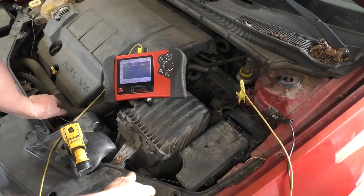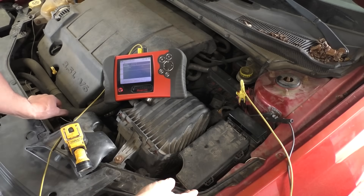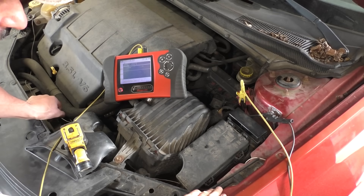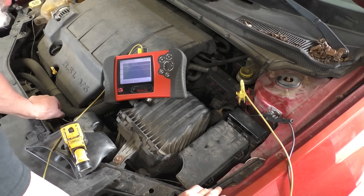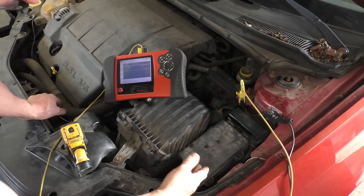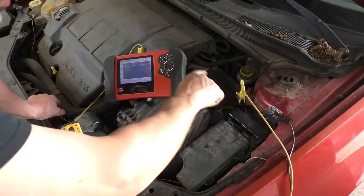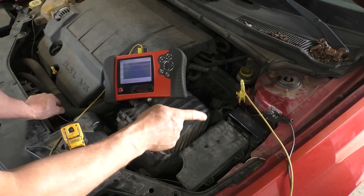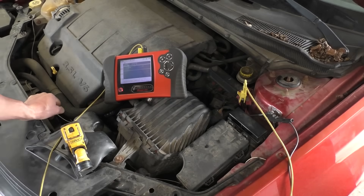Even your conductor, even your wire — that's why we can't just take a piece of four-gauge wire and run it for miles and miles and expect 12 volts out the other end, because there's a certain amount of resistance in that wire. Just like there is at connections, fuses, relays, terminals, switches — any component in the circuit is going to have a certain amount of voltage loss across it. So let's have a look at what this car is doing and prove it out.